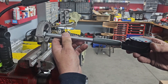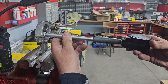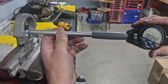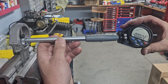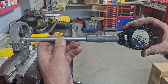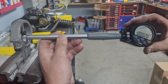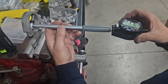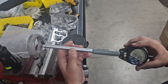We're working on a set of Porsche 912 rods today. We've cleaned them and I'm checking the big end size on the rod — checking for ovality as well as size. Right now this one's right there; maximum deviation is 0.02mm and we're right at 0.02, and right across the pin size we are 0, so this one's not too bad.